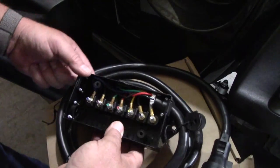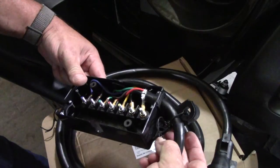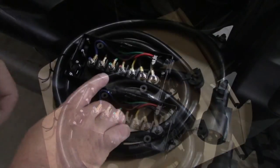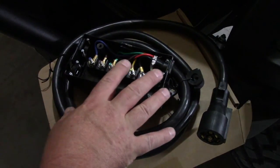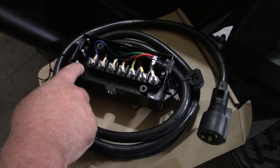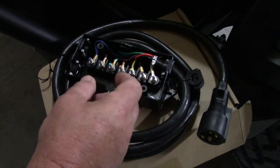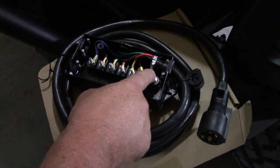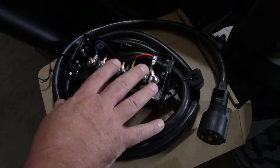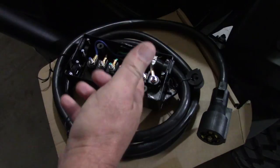You can take this and actually mount it back on your trailer somewhere. It has mounting tabs with holes — looks like about a quarter-inch hole — where you can mount this thing solid and it will be waterproof. The Bogue RV trailer plug box is made from flame-proof ABS. It has four open-closed grommets that come with it. This is a much easier way to manage your loose wires instead of using butt connectors where water can get in and cause bad connections. You'll definitely have a good connection using these lugs. With this, you also get a two-year warranty.